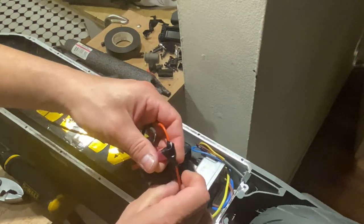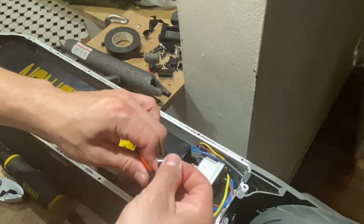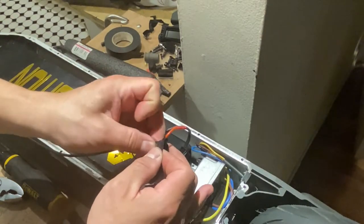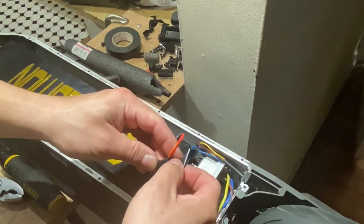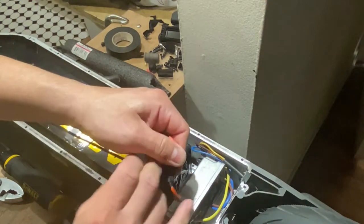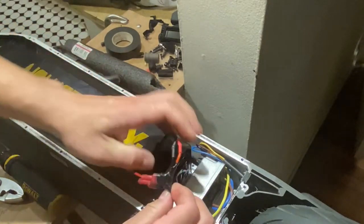We're going to secure the red connector completely by adding electrical tape around it. See how I'm doing it — this is not just rub it and that's it. You have to do it in an X, like an X turning, so it actually catches the end of the terminal with the connector and the T-connector in the wire. As we know, there is a lot of vibration near the rear tire, so we want to make sure that these connectors never come off. That's how it's done.